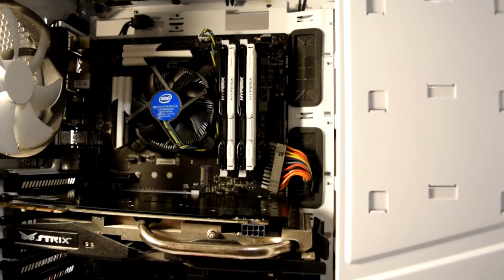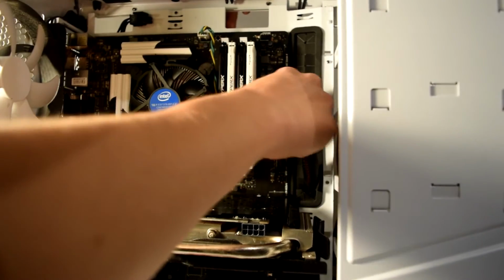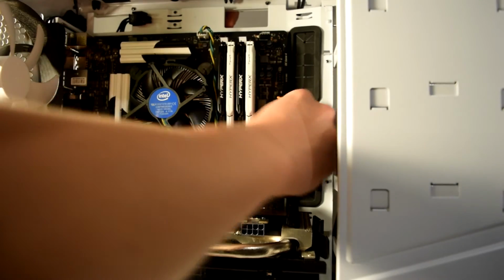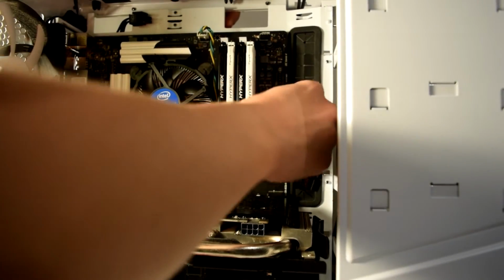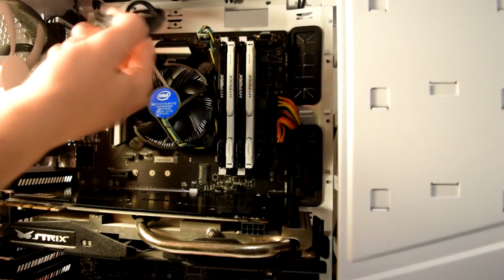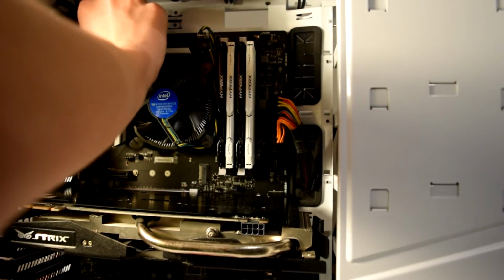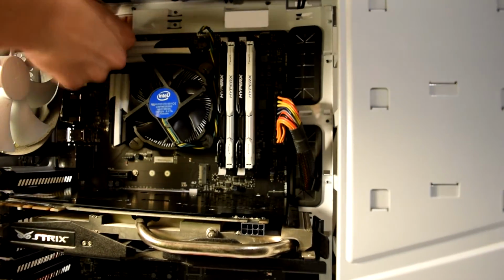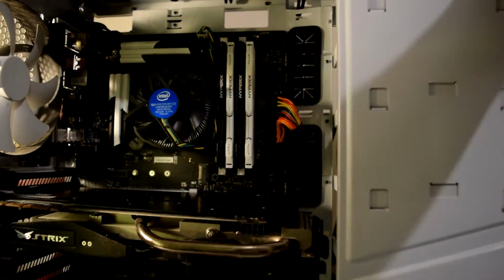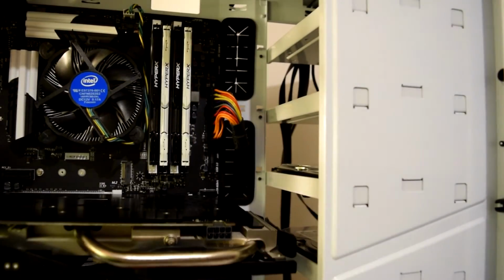So to install the power for the motherboard and everything. For the 24 pin, grab it, locate it, plug it in. It should click in, but because of how it used to be, it never will now. Then get the CPU power, twist it around the right way. This is an 8-pin, and plug it in, and make sure it's seated. I'll probably do cable management in my own time. Twist the thing around, which is getting heavier and heavier.